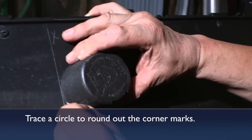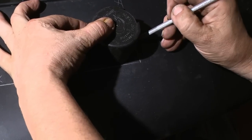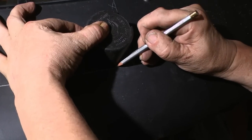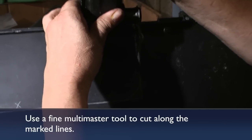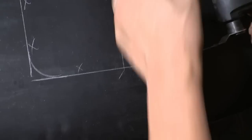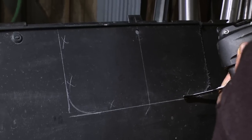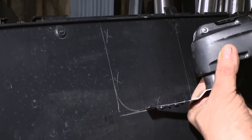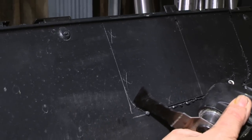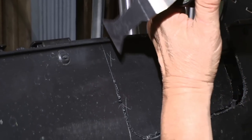After putting the bottom reference line in place, use a common paint can cap to dress it up a little and cut some radius corners into the cutout piece. Once your layout is done, go back to using your oscillating cutting tool to carefully cut out the plastic material. You can make a very precise cut — get yourself in the right position, hold onto the tool firmly, and have somebody assist you if necessary to hold the bumper cover in place. Always set the bumper cover on soft padding so you don't scratch the finished surface.